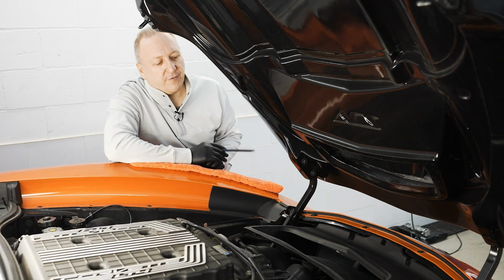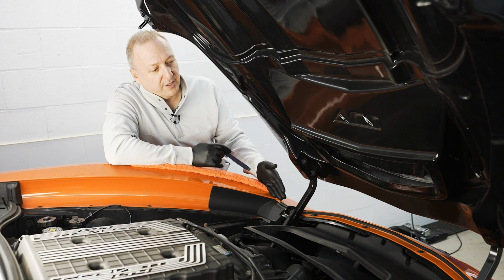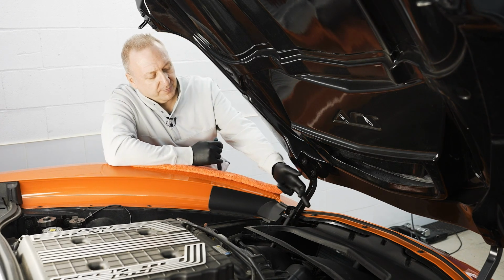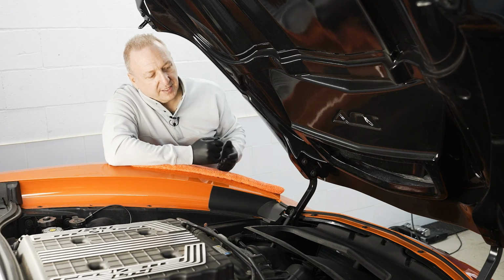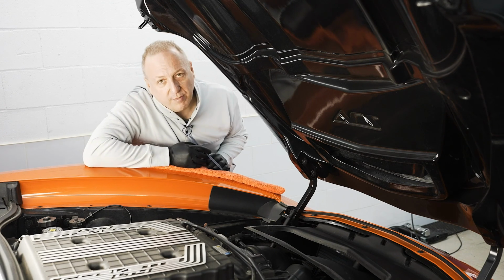We're moving on to the front leading edge of the bumper, which is basically located right under the hood. So we've popped the hood. We have a fastener under the trim bezel, a clip, and then a series of T30 bolts that we'll be removing. Step 1 is removing this trim bezel here.